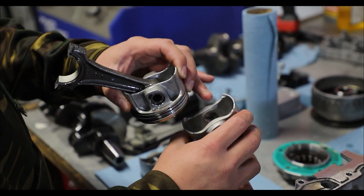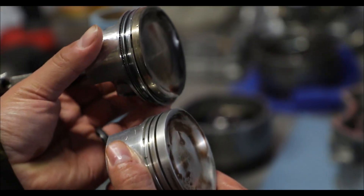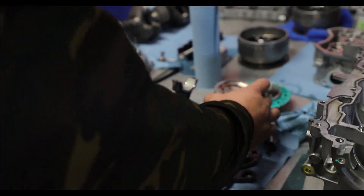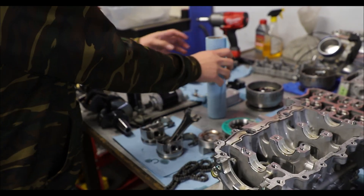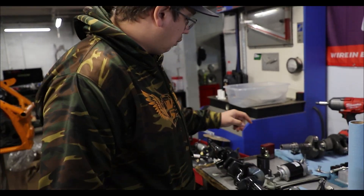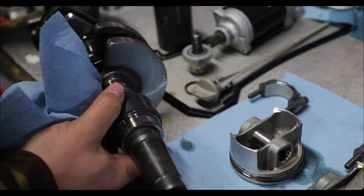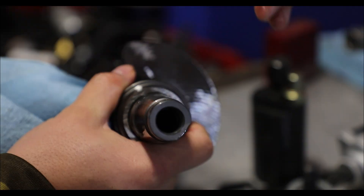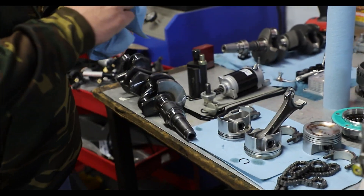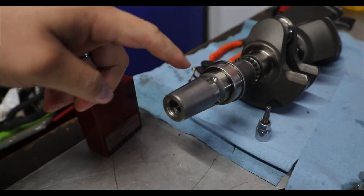The RR piston we could comfortably run in the 40 psi boost range on E85. There's more strength added in the pin boss area and they're also lower compression — you can kind of see how much bigger that dish is. So this is still a high compression turbo engine out of a Can-Am X3. The stroker kit we use is X3 based, so it won't have the D on the end of the crankshaft. All the Ski-Doos use a tapered D-lock to lock the clutch in.